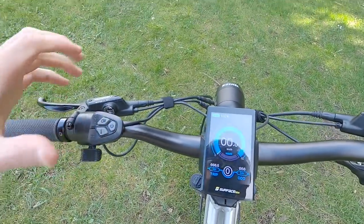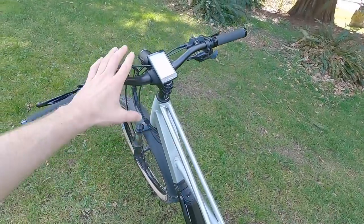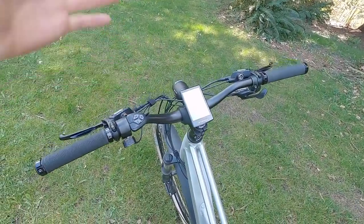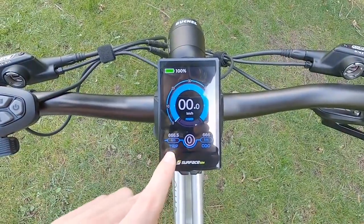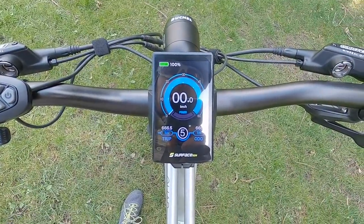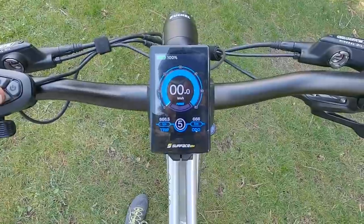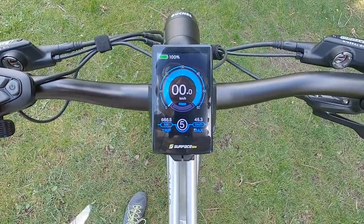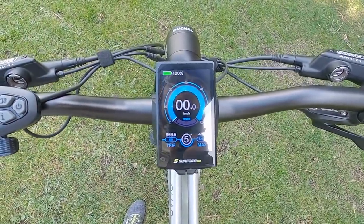With the throttle hot in zero, you can turn off pedal assist and control the bike almost like a dirt bike. Be aware: if you turn the bike on while not seated and press the throttle, it could take off and tip. Down at the bottom of the display you've got trip distance, odometer, and plus/minus buttons to cycle through the five assist levels. The info button cycles through max speed, average speed, time, odometer, and loops back around. Holding the light button for a few seconds activates the headlight — the display dims automatically when the light is on.